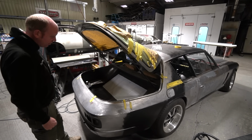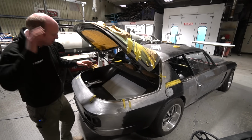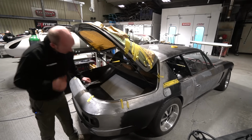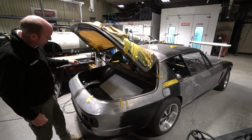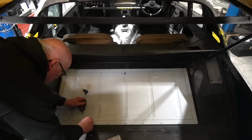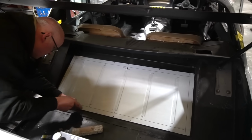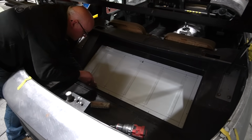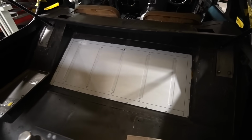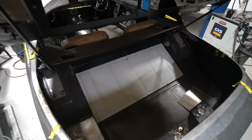And then he's used the Pull Max, Pell's Nibbler, chooses to identify as a Pull Max machine to put the swages into that. And I was just commenting earlier, actually, prior to doing this video, that it's pretty impressive. You realise the value of a machine like that. That can put these 25mm wide flutes, which are around 3mm deep, into 3mm thick 5251H22 aluminium sheet. That's some force being exerted. That is quite hard material to swage. So that tells you all you need to know about the forces that machine can exert. It's quite impressive. So that's where we're at on that at the moment.